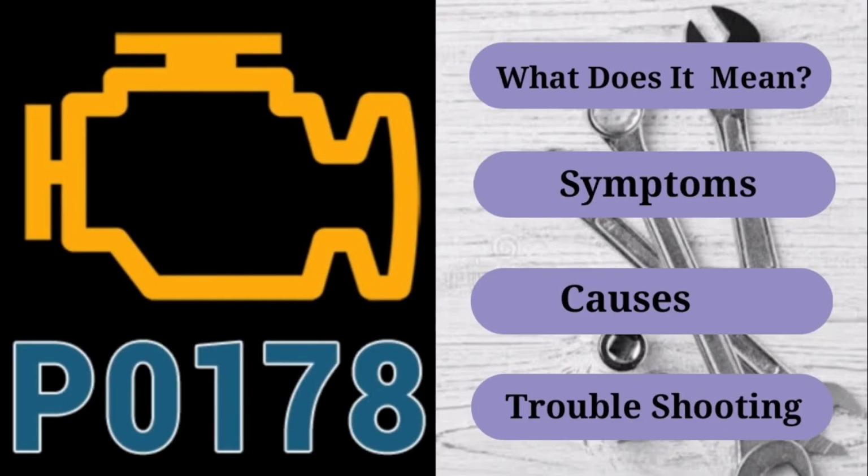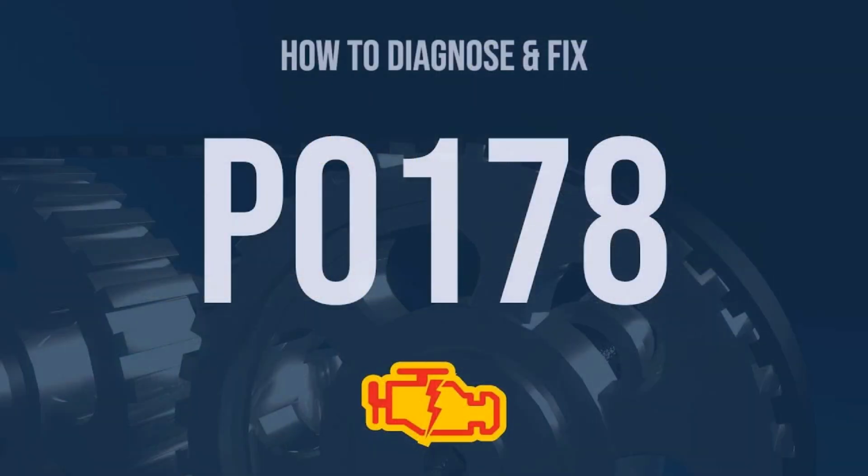Diagnostic Trouble Code, DTC, P0178 indicates fuel composition sensor circuit low. Also known as the flexible fuel sensor, the fuel composition sensor measures the percentage of ethanol in the fuel. Most vehicles can only burn fuels containing a maximum of 10 to 15% ethanol alcohol before their engines start to develop problems. This is because ethanol fuel has a higher octane rating and burns less well than gasoline. A flexible fuel system allows the vehicle to burn fuel containing up to 85% ethanol, E85.